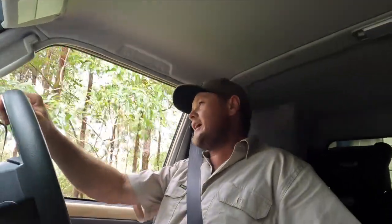They ride pretty firm, I'll be honest — it takes some getting used to. But because we bought this to tow, once you're hooked up with the van and fully loaded, the thing drives nice and true straight down the road. It's a compromise. We set it up with a heavy leaf spring pack so it stays in the middle of the road. If you set a four-wheel drive up soft for comfort and then put a heavy load on, it starts walking all over the road. That's the compromise we made, and being a leaf-sprung rear, it's never going to be as good as a coil-sprung vehicle.